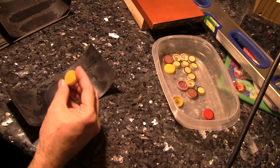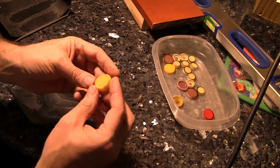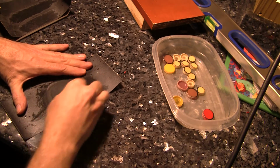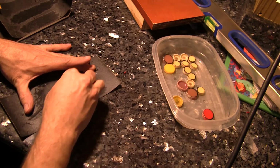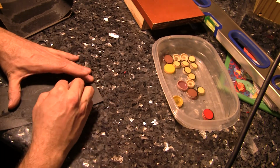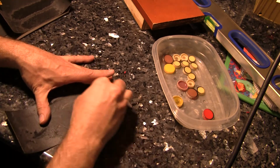And you'll notice it's taken the black ring around it off. This is an unfortunate side effect of leveling it, that we're going to take that paint off. You can either choose to reinstall it without the ring, or you can add the ring. There's a lot of different techniques for that I can go into later too. But first, we're going to level this, because our focus is getting this playfield playable. We're more interested in it playing like the original game than we are in it being showroom quality, as you would say.